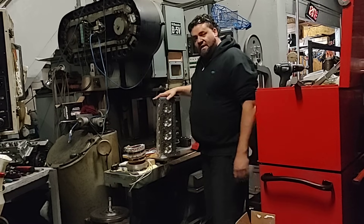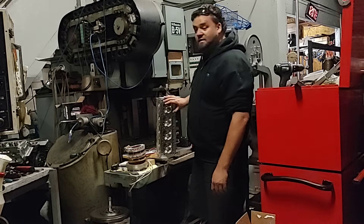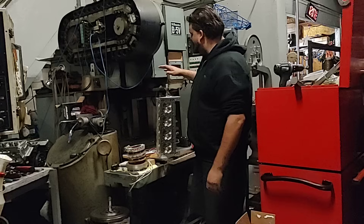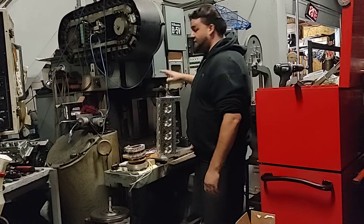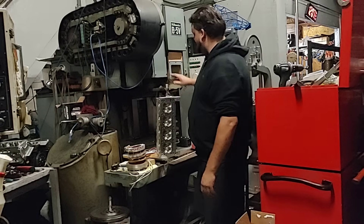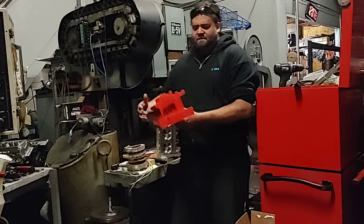They flow about 380 on the intake and 250 on the exhaust. They fit the 53/48 bore and can be blown out to be bigger. Those flow numbers are just off a very rough 3D print, so the numbers will probably increase. These are not a double overhead cam — they are a pushrod-activated shaft rocker type system.